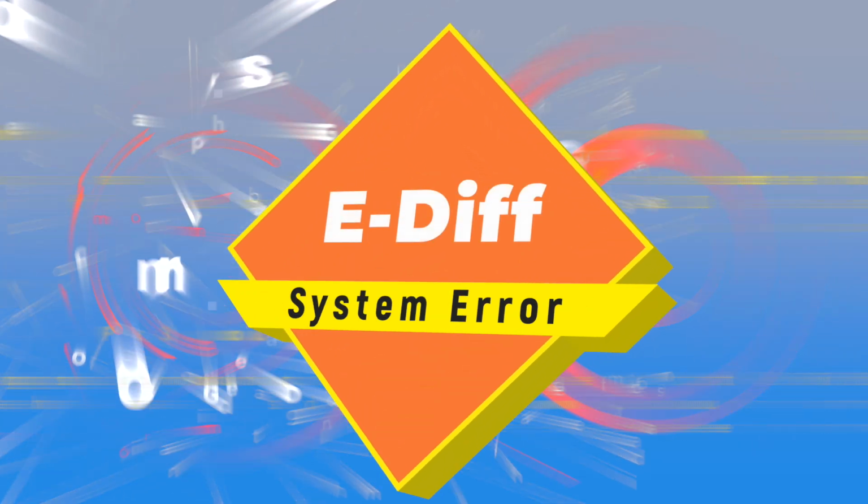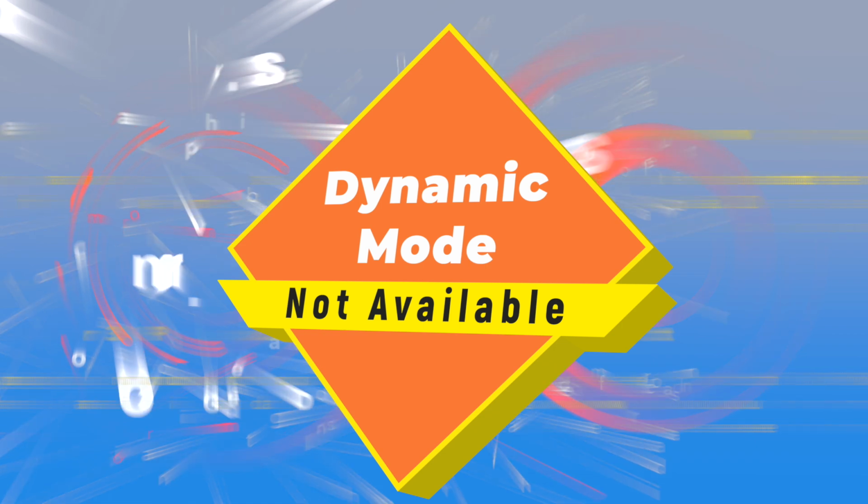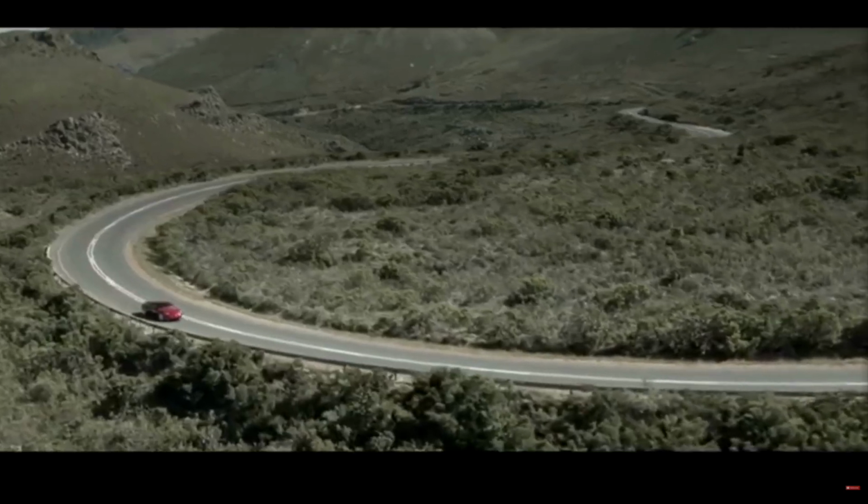And now E-Diff. Watch out for this warning code on the 5 litre cars with a message indicating E-Diff system error or dynamic mode not available. E-Diff can also be an issue on the earlier XKR models, which can cause a vibration when cornering and accelerating.